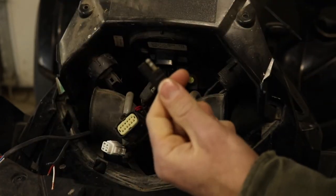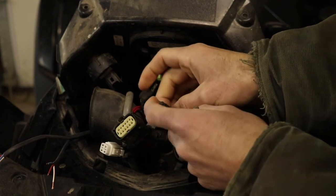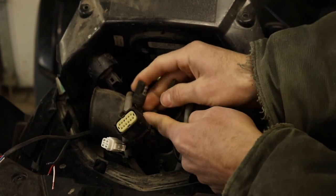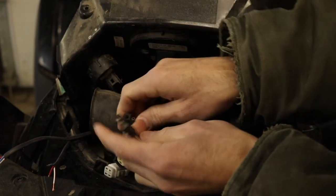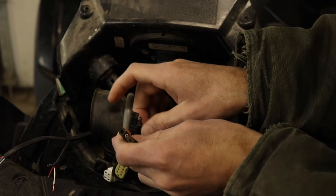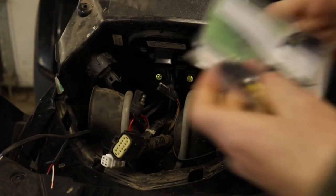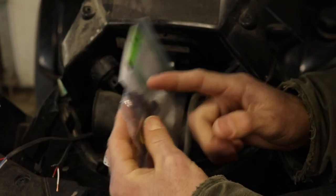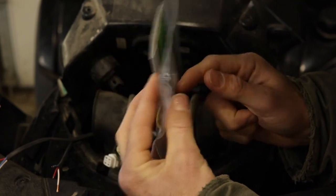So, you have a two-pin trailer plug — that's what this is for the accessory plug. That's what I used here to solder this onto my winch plug. To get two in here, because I have grips and a winch, Arctic Cat has this splitter. So I'll have a winch and heated grips plugged into the accessory plug.